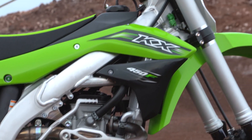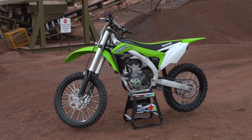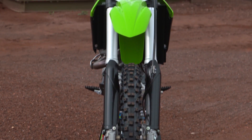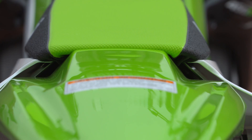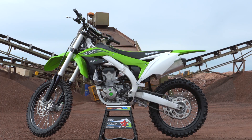The thing is slimmer, it's lighter, and when you ride it, this thing almost feels like a 250. The forks have got a different coating that takes away a lot of the stiction — it doesn't grab, nowhere near as grabby as the 2015 model. At the very rear end, you've got two holes. It's almost like an air induction, and they're facing to the rear of the bike, which means clean air going in and no risk of any dust coming in that little area right there.